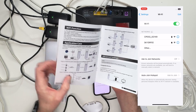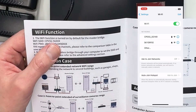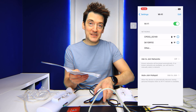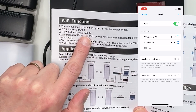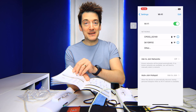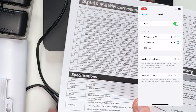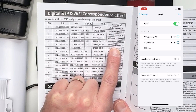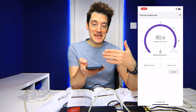To find the password, go to page seven of the user manual. The Wi-Fi SSID shows CPE5G and then 5G-XXX — the triple X changes based on the channel selected. Because we chose channel five, the last three digits are 149. Scroll along in the manual to find the corresponding channel and password, click to join the network, and there you have it — a fast Wi-Fi connection.